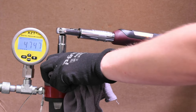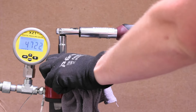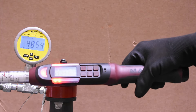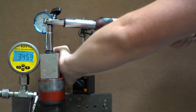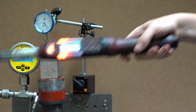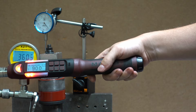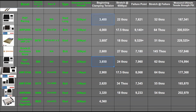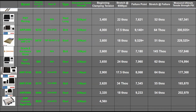Using ARP's suggested torque procedure we see as high as 4,800 PSI, which eventually settles to the mid-4,500s. This is well up on the L19 stud where we saw 3,600 PSI — admittedly a longer-style LS1 stud, but we previously saw little difference between longer versus shorter studs from the same kit. So the CA625+ is already topping one category: starting head clamping pressure, which should help for high-boost applications.